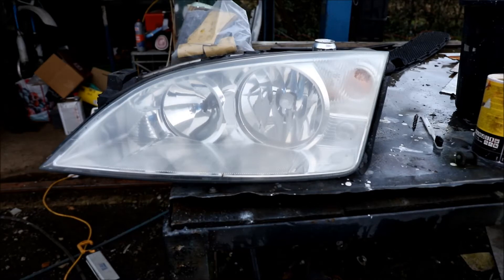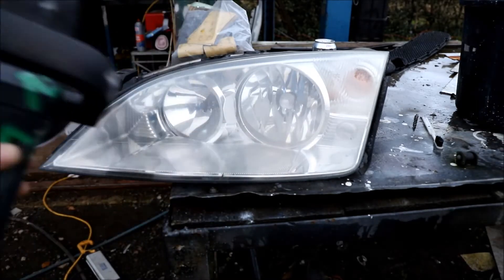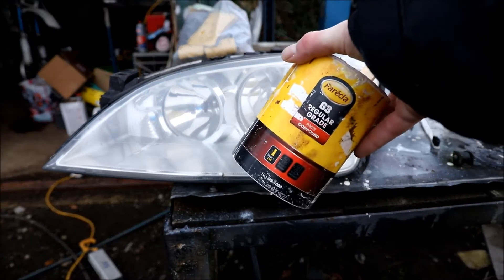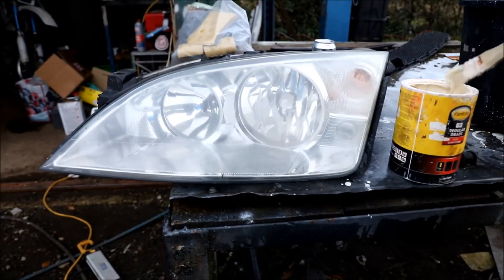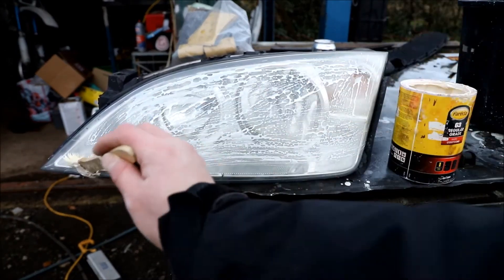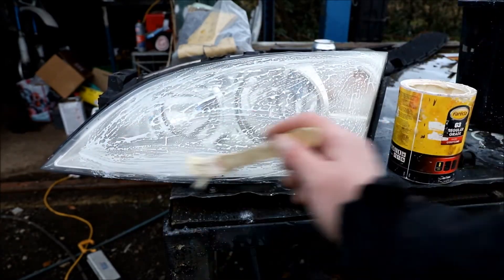I really wasn't getting anywhere hand polishing it — I think it's just a little bit too cold. So what I've done is I've got the polishing wheel with a pad on and used a very thin amount of G3 cutting compound. I'm going to do it again — I've really wet the paste and I'm just going to go over it very lightly, just to cut it, then I'll dry it and then I'll polish it.